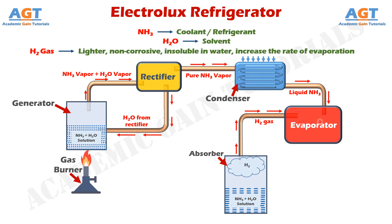After extracting heat from the evaporator, the ammonia liquid turns into ammonia vapor. Then both ammonia vapor and hydrogen leave the evaporator and enter into the absorber through this pipe. We already have water inside the absorber, and since ammonia is soluble in water, the ammonia vapor gets mixed with water and forms an ammonia-water solution. Since hydrogen is insoluble in water, it will again go upwards and re-enter the evaporator, mixing with ammonia liquid to produce the refrigeration effect. Then again both ammonia vapor and hydrogen come to the absorber — ammonia vapor forms a mixture with water, and hydrogen gets separated, and this cycle goes on continuously.